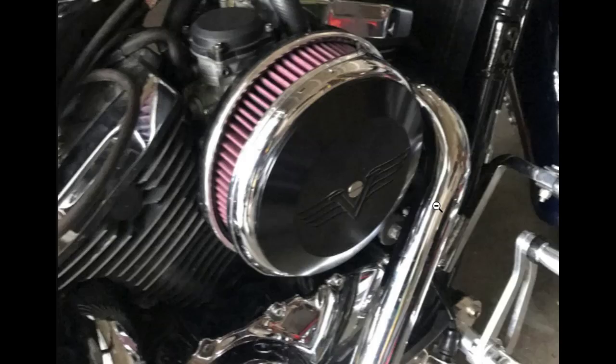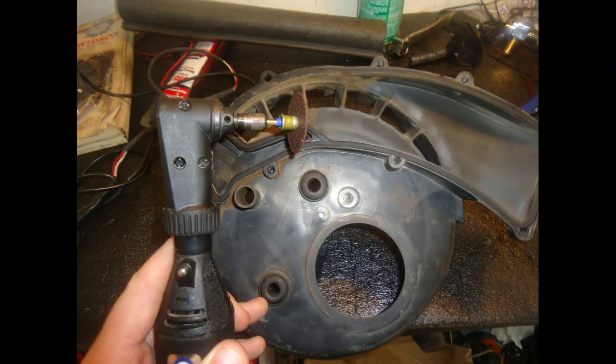There's also a popular modification that is called scooterizing or Gremp-sizing. That is a heavy modification. It's doable at home, but it is a modification to the original airbox, cutting it open essentially and using a K&N filter to improve airflow quite a bit. Essentially, you triple the airflow.